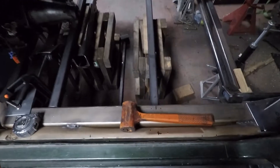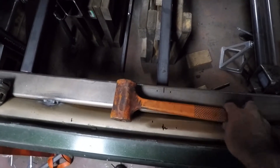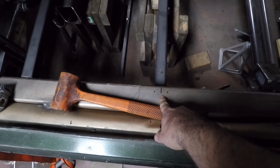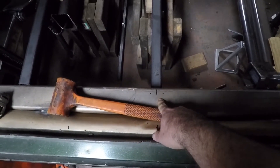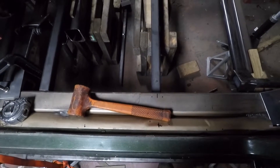What we're going to have to do is relieve these into the sidewall so they'll actually sit on top of the bottom section of the frame. And then we'll have to window out a little bit for the bolt hole to mount these in. But otherwise, everything should work fine.